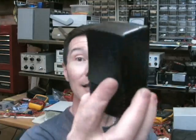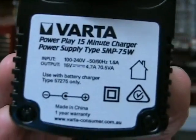It's going to have one heavy-duty power supply in there to cater for all that — this thing requires a lot of power. Check this out: the plug pack that comes with it is a 15-volt, 4.7-amp, 70-watt plug pack. So even if it's reasonably efficient, it's still going to get quite hot during charging. That's one decent plug pack.